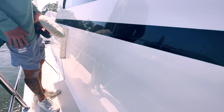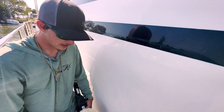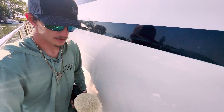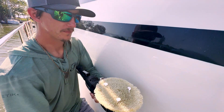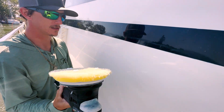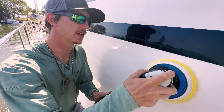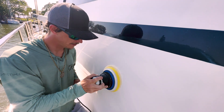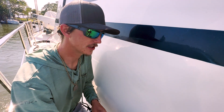So far, after that first pass it really cleaned things up — the surface actually looks really good right now. We're just going to brighten it up with the Elevate and really open it up, get it ready for the next step, which is alcohol prepping and ceramic coating. For the Elevate step, we're using a Rupes wool polishing pad. I do three little dabs — the machine is a Rupes 21 long throw, pretty sweet machine, it rips. We're going to dab into the surface, spread it around, turn it down to one just to blend everything in, and then I'm going to turn it up to about five and let it do its thing.